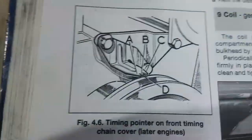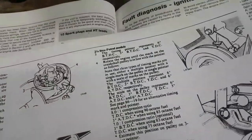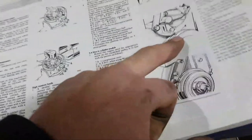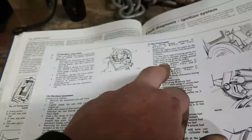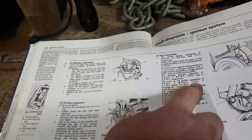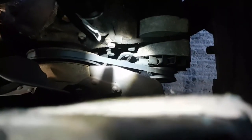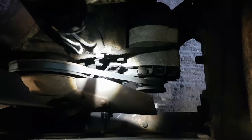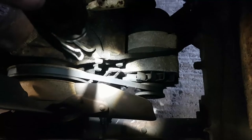I need to go and work out what those marks are because they don't look like these marks. Found a proper Land Rover manual — two and a quarter petrol models. This is the marker I've got. That style is the one that Haynes likes to report against — that style is different. This is the one I want: multiple pointers represent six, three, top dead center, and six after. So basically I've got after top dead center on this — I need to crank it over again. I want it on the second of the small ones because it's just past top dead center. I'll get it over to the second one and then we'll probably need to mess around rotating the distributor. But that would explain why it's not working.